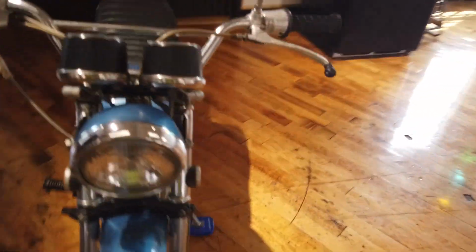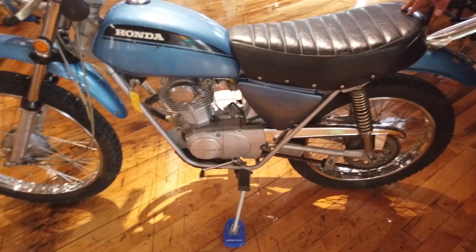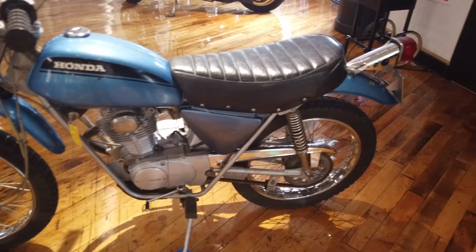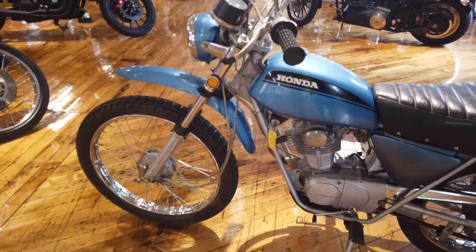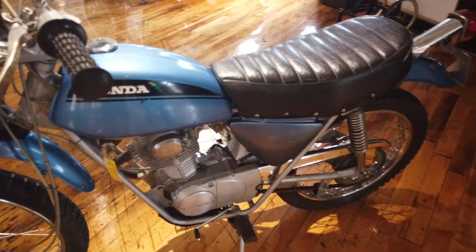We just brought it through the shop. Chris gave it the thumbs up. We did a compression test, tested perfectly. I believe this had 160 PSI. I was reading the sheet. It's either 155 or 160 PSI, and I'll note that in the description. Runs exactly how you'd expect. Gearbox feels like a bike with 1,000 miles on it.